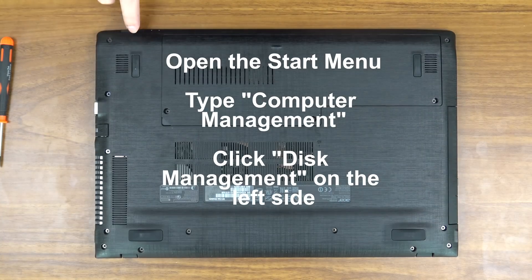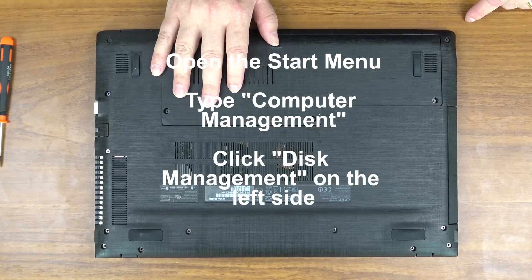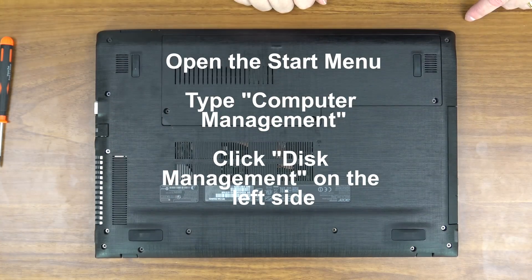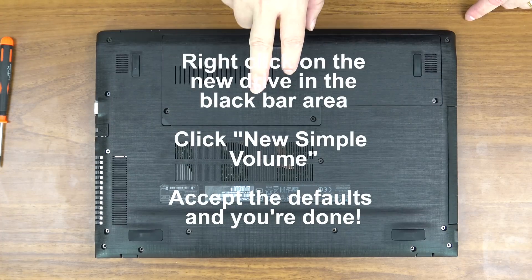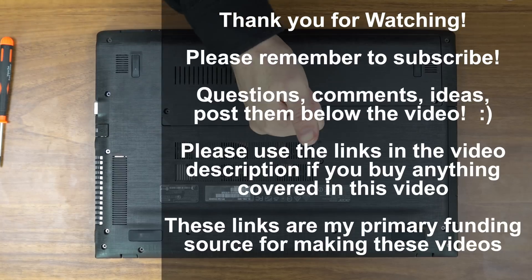It might also show a blank space for the memory card reader — each machine is a bit different. All you have to do is right-click on the empty hard drive that you installed and create a new simple volume. It'll default to take the full size of the drive, auto-assign a drive letter, format it for you, and you're done. It really is pretty straightforward.